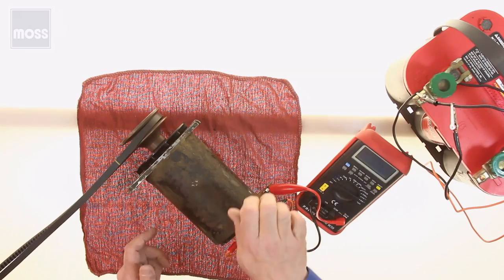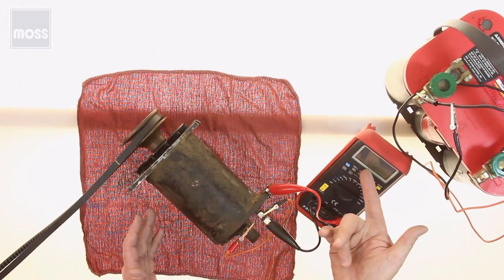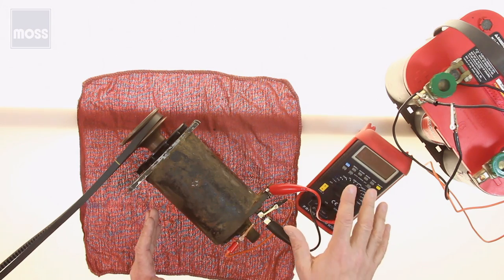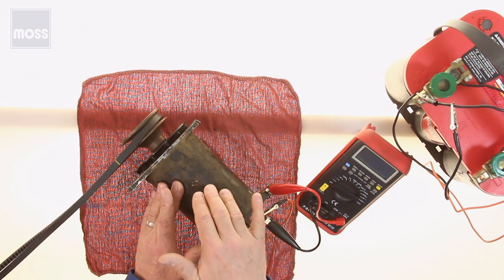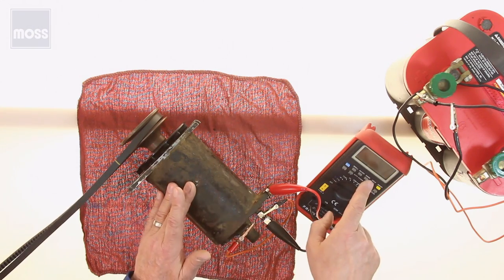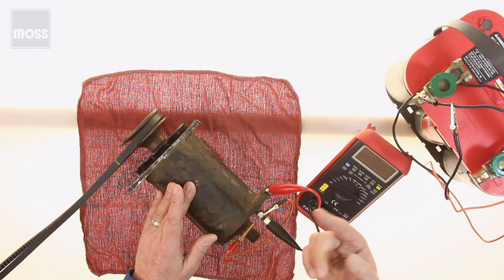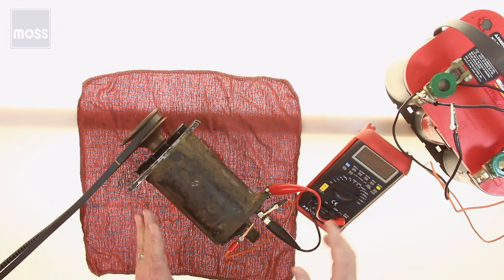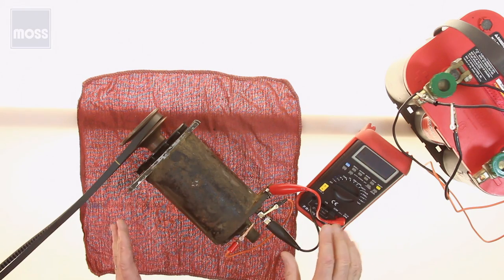Our voltmeter is here. We start our car. The motor settles out at idle speed, and all we have to do is look at your voltmeter. Okay, if we're getting 14 volts, maybe a little more than that, this is working great. We've not only proved that it works well. We're done. But keep an eye on the voltmeter, because if the voltage begins to climb, 16, 17, 18, 19, 20 volts, anywhere up in there, it's time to stop the experiment. We've already proven it works. You don't have to go any further.